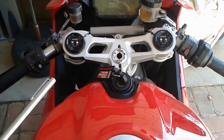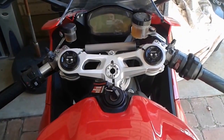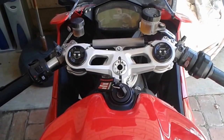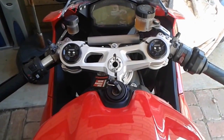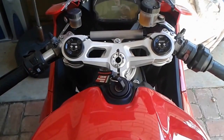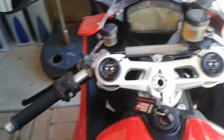In the last video I talked about security and how there's a sensor in the top part of the ignition key, and how it tells the bike it's the correct key and shuts off the immobiliser. What I forgot to mention was if that key is damaged or no longer works, how do you access your bike if you've locked it and you're out in the middle of nowhere? Well, there's a PIN code that you can enter on your machine — like your ATM bank card — and that will disable the immobiliser and get you out of the pickle.